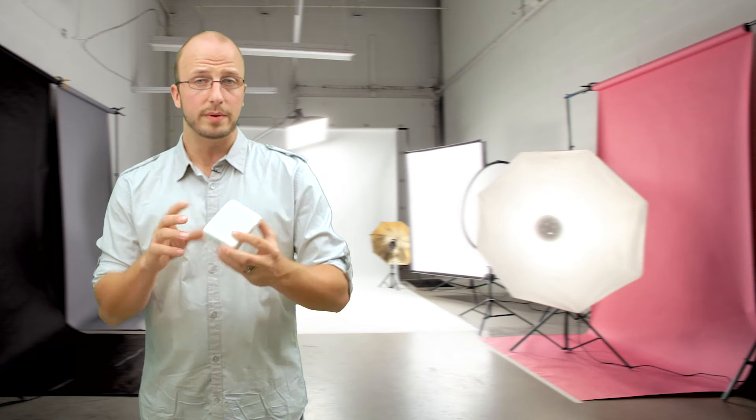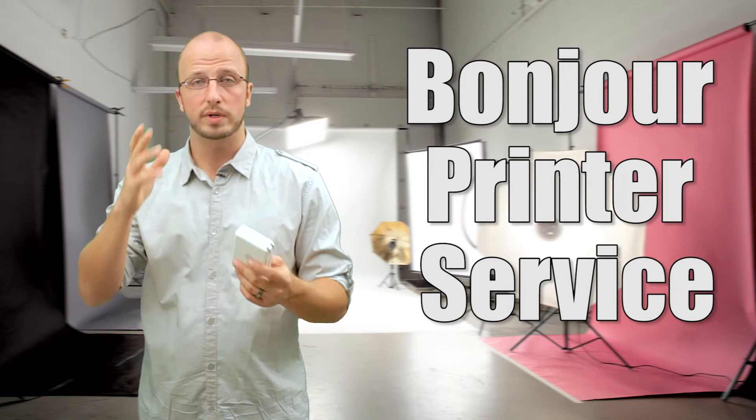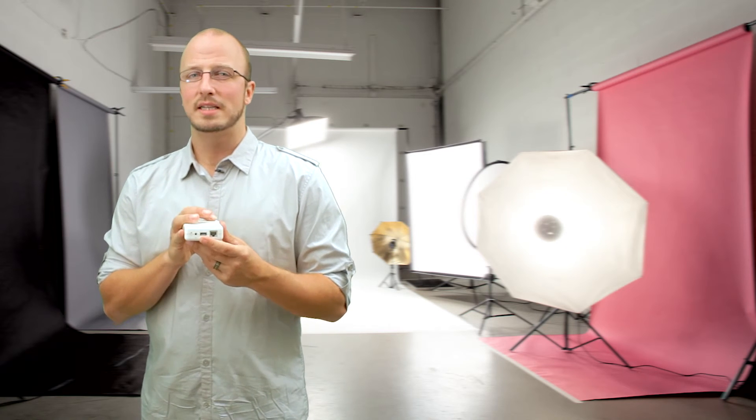When it comes to your wireless printer, a little more work is to be done. You'll take any printer you have as long as there's a USB connection, plug that in, and then download from Apple's website the Bonjour printer service — make sure you get the most recent up-to-date version. Install it and start it up and it will auto-magically detect your printer. About 95% of the time it will choose the right printer, and when you go to print a Word document you'll find that the wireless printer shows up.